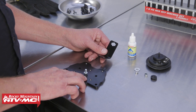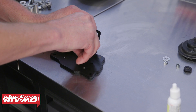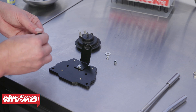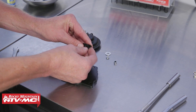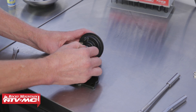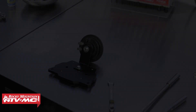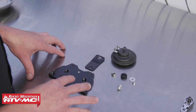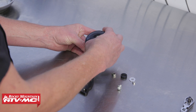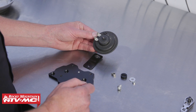Next let's take our horn mount bracket and mount it to our fender mount bracket using this M6 bolt. For this bolt and all the rest of the bolts it's not a bad idea to use a medium strength thread locker. Let's mount the horn using the stock hardware — just install it the same way you took it apart. When you mount the horn make sure to rotate the terminals to the left side so that it's easier to plug in once we install it on the bike. Now if you're installing this kit on the 1290 it's the same procedure except you'll use a short bracket and mount the horn flipped directly over, straight up. The orientation of the horn will be the same — terminals need to be on the left — and we will just bend these electrical terminals down so that they're flat and straight.